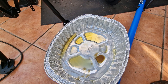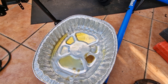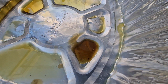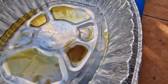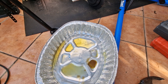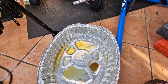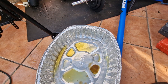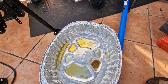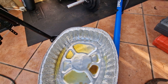I had suspected this performance fork might not be optimal, and there was a lot of negative pressure in it when I released the lowers. The oil is actually quite filthy, and for a fork that's not done a lot — probably 10 to 15 hours of riding at that — that's disappointing. Compared to the factory fork I released, which was perfectly clean, yeah, not great.